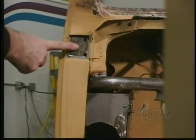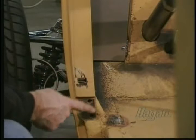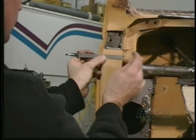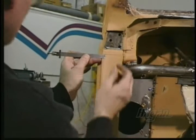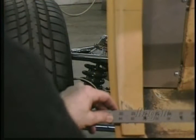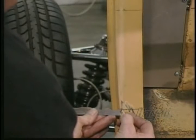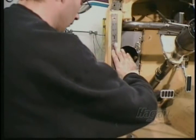The new hinge receivers will not go in the stock location. The top tube will be below the original hinge and the bottom tube above. This will eliminate cutting into the original bracing. Select a position below the original hinge and away from the inner brace and draw a horizontal line. Now mark 5/8 of an inch from the outer edge. Connect these two marks with a straight edge. The line must be on or to the outside of the maximum 1 and 1/4 mark.